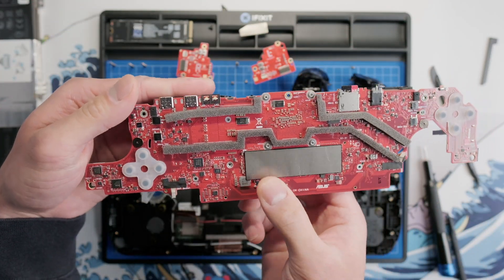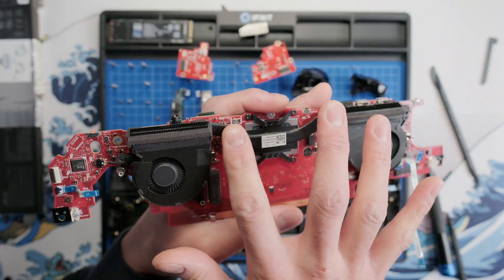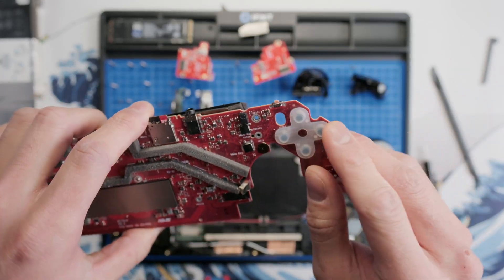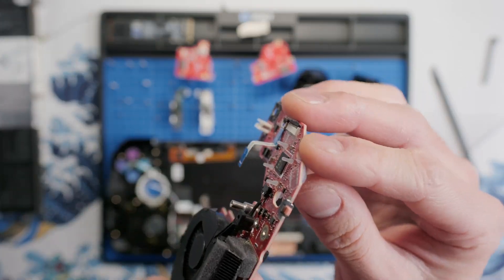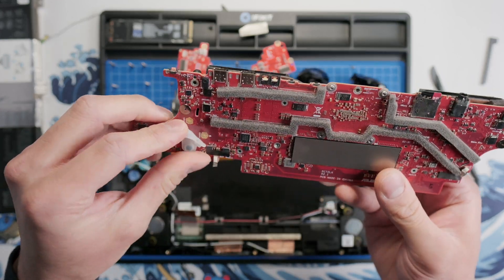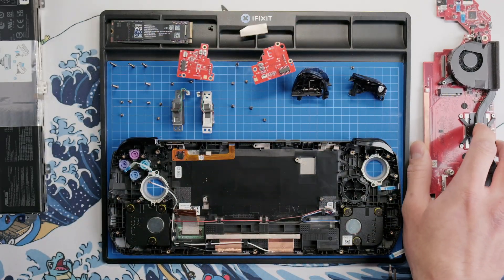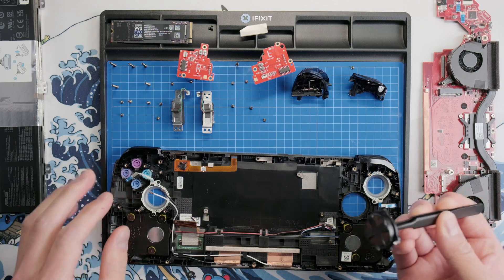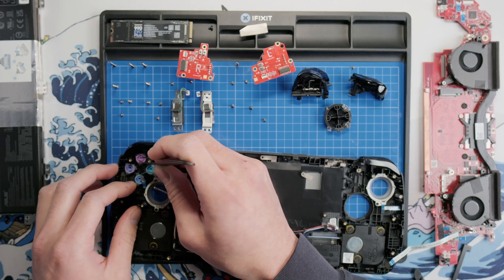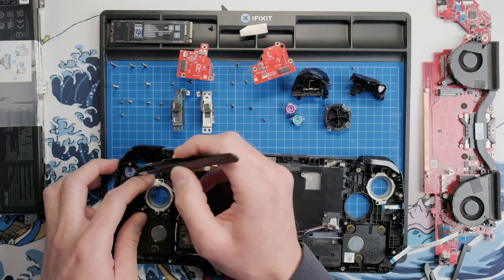If we flip the board around, we can see some more insulating tape covering up some chips. We can also get a better look at the CPU cooling assembly with the two heat pipes leading to the two fans. The D-pad and action button membranes are captive, held to the motherboard by parts that anchor through the board, which is nice so we don't have to worry about misaligned membranes when reassembling. The D-pad and action buttons can be removed with tweezers or just your fingers. If you're wondering what the bits of hot glue on my buttons are for, click the subscribe button, as I'll be making a video on this mod and how it greatly decreases the loud clackiness of the Ally's controls.